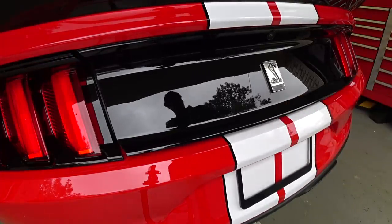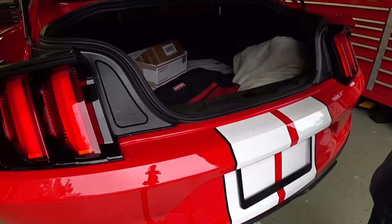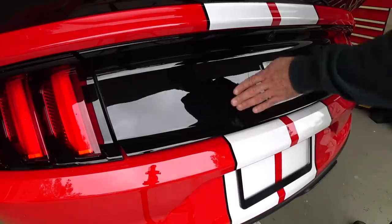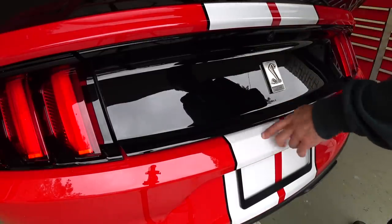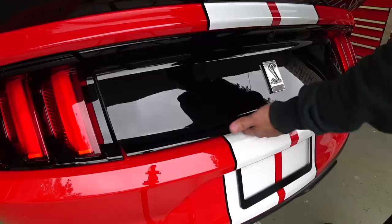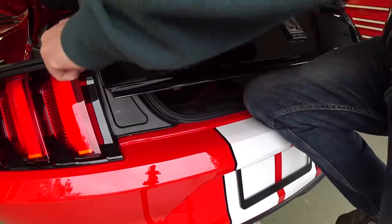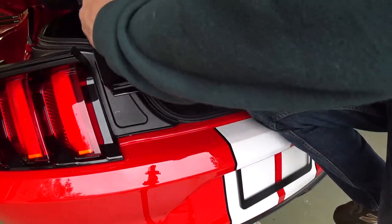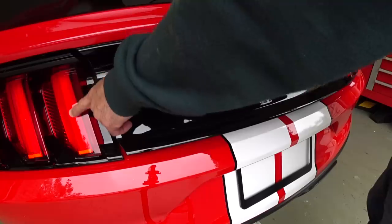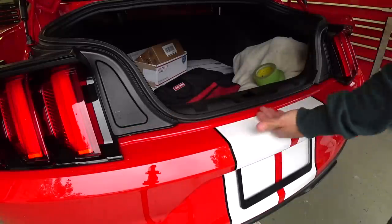Now before we go further — when working on a trunk, I always take a screwdriver and lock the latch. This gives you about another inch of clearance so as you're coming down with your machine, you're not going to burn into the bumper, or in this case, into the vinyl decal. That's a little tip. Also, as you're doing it, you can put your knee under the deck lid and work your machine along. I'll show you guys how I do that so you can constantly get to the edge without hitting the tail lamps and causing burn marks or edge wear.